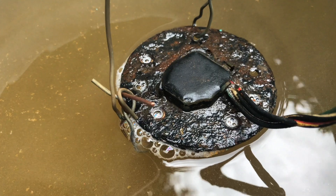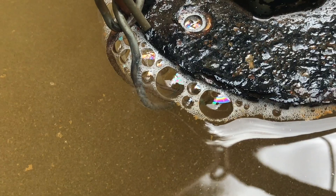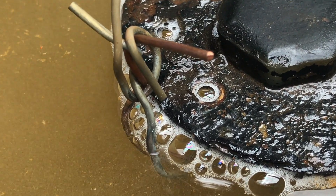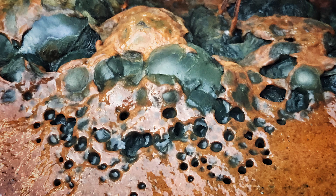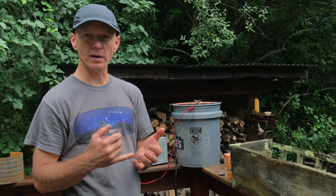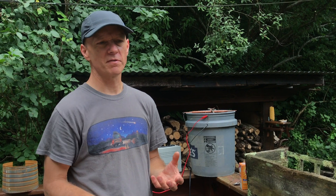If you want to do more research, there's a lot out there. Right now I've got my fuel level sender in there and it's been sitting overnight. To truly strip something 100%, you really need to give it some time. This thing will froth up and get really gross. Everything that you've put into that water is what's coming out. Even though it looks really gross and toxic, it's basically only the soda, your water, and rust. And if there's oil or paint, that'll be floating on the top as well. You can dispose of that stuff without creating any kind of major issue.